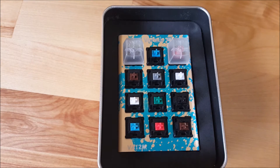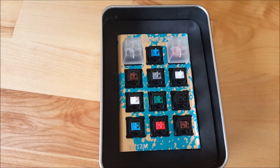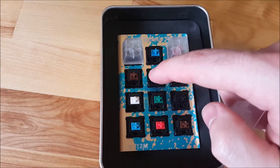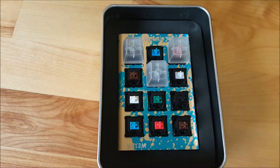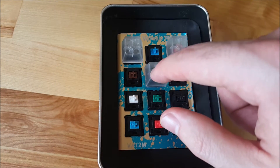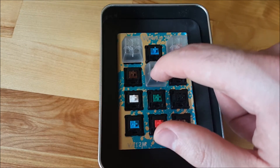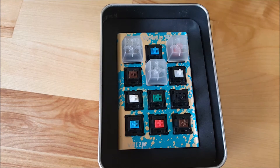The next switch is Cherry MX Gray. Cherry MX Grays can actually be linear or tactile — this one is linear, and it's the stiffest of the linear switches. This one takes 80 centinewtons of force, so 45, 60, 80. This is a really stiff switch. I don't know if you'd really want a full keyboard full of them — your hands might get tired pretty quickly. I think some people like to use them for the space bar specifically.